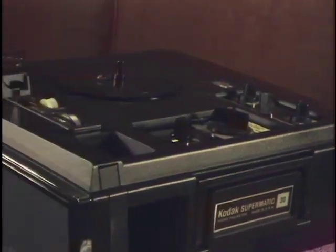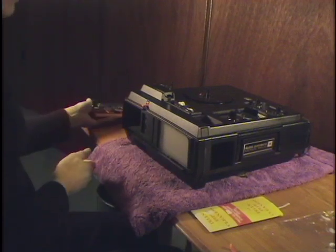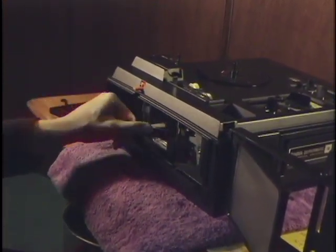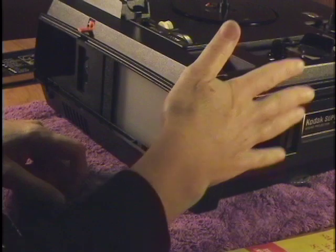Now I'm going to show you how to clean it. It also has sound, and in its day had the ability to record sound — I never used that function. The first thing is to begin taking it apart. You can see it's got a couple of handy features, like a backup bulb should you blow one. It's also got a way of taking this slider out altogether by pressing the little outside lens over and holding it down — then it slides out. You can lubricate this slide with my cleaner of choice: Lemon Pledge Furniture Polish with Carnauba Wax.